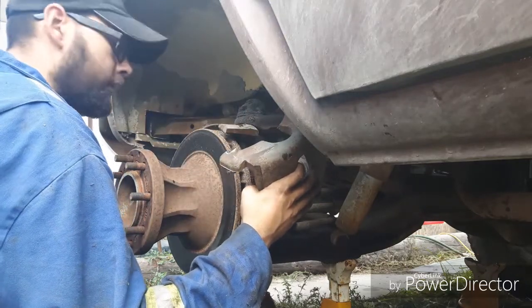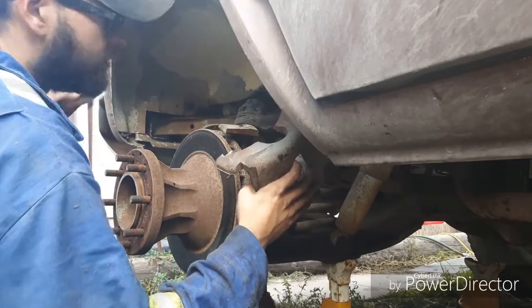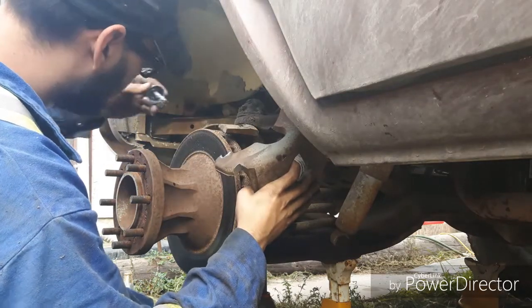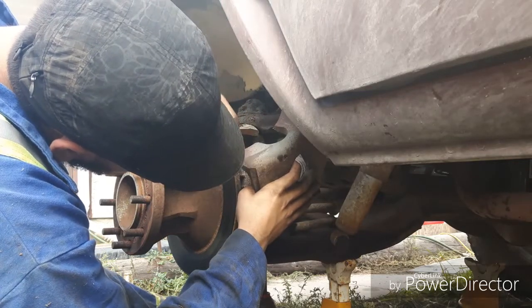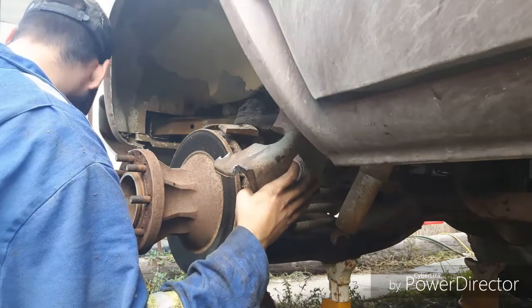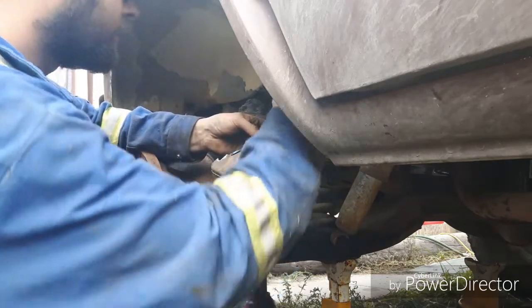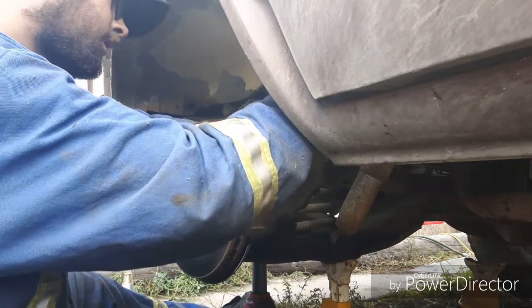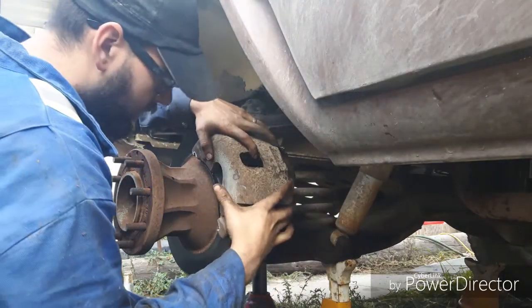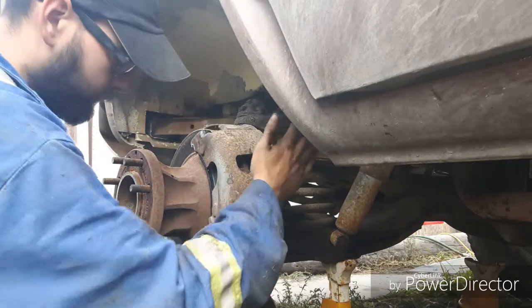Yeah, got a little anti-seize on that. Backside as well needs a little. Right here. There's that spider web on there. And a little right up top here too. There. Alright. Now I'll slide the pad into place. There, pad slid into place. You just put this in from the top side and the bottom. Well, twist into place just like so.